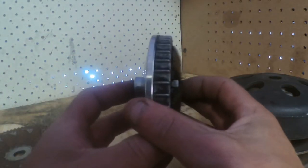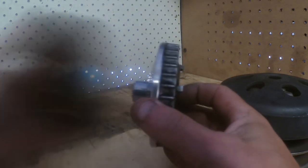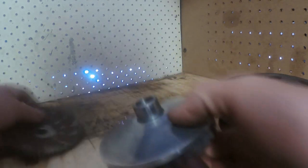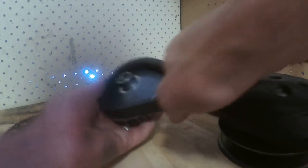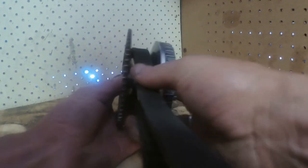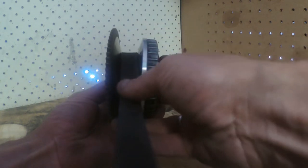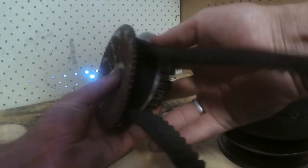So what we're seeing is that moving like that, and the front plate assembly there. What it's doing is squeezing the belt — the belt is sitting in there. And then as this assembly starts to squeeze, it's going to expand. So at idle it will sit like that, and then it expands to change the front gear ratio.